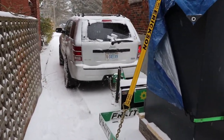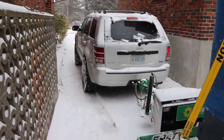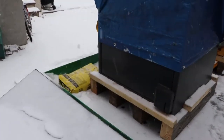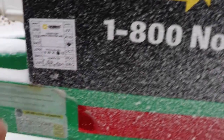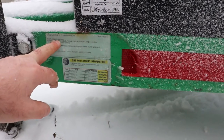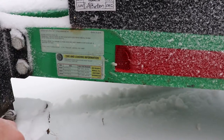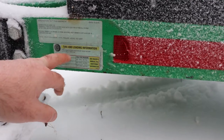The Jeep is not rated for this much weight — obviously it's not quite lifted off the ground — but my hydraulics were able to lift it, which is kind of nice. I do have a bag of sand there just in case I get into some trouble. Looking at the ratings, this trailer is good for 9,500 pounds all in, with about a 2,500 pound trailer weight, giving 7,000 pounds cargo capacity.